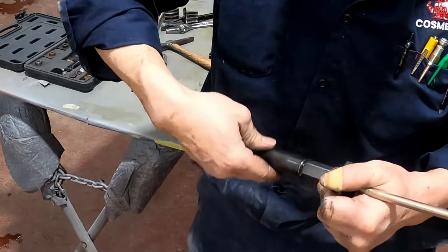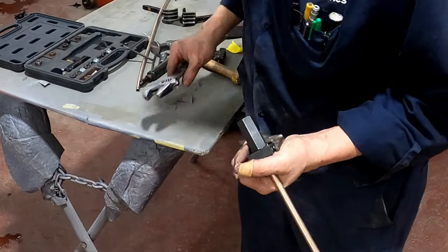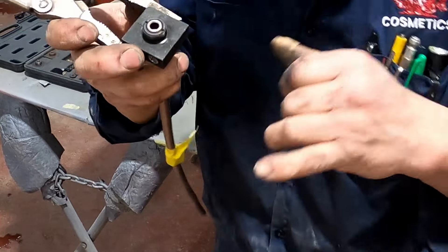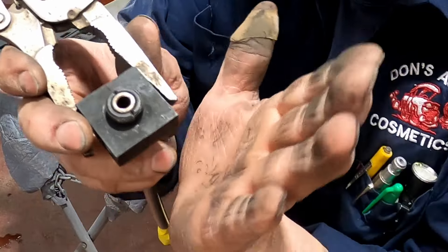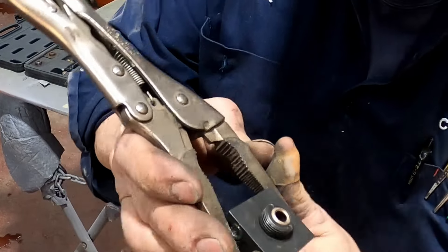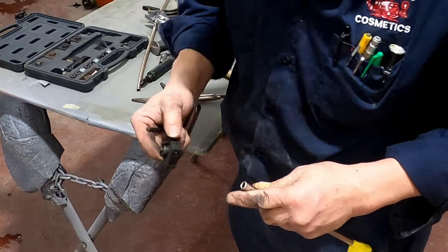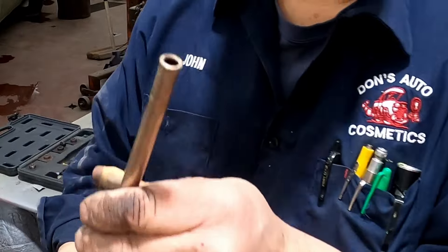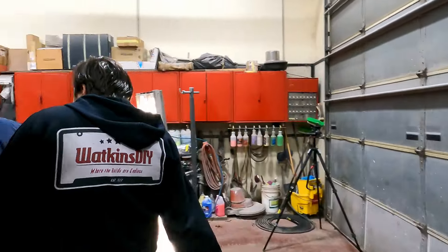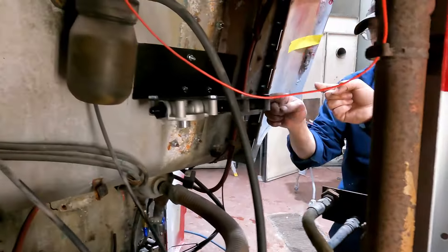Crank this out. Just put a little bit of pliers there. And this is what it did — it pushed that over-piece right in, nice and smooth and clean in there. We have a flare that looks like this — that's what you got, a double flare. We have flared it out and in, out, up, over, and that way.